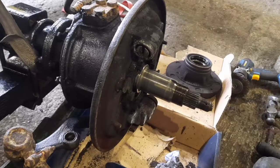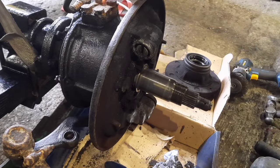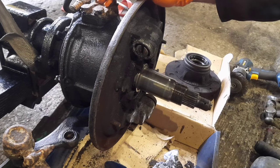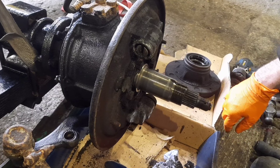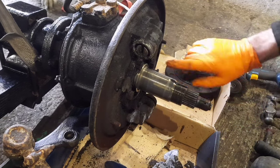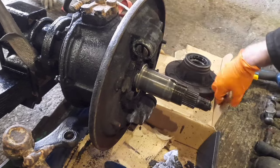The wheel cylinders, obviously all this lot of scrap. So we'll pull the cylinders off, pull all these brake pipes and stuff off. I've got the lock tabs to replace on this side as well. And I'll get in there with the wire brush, I think, try and tidy up the back plate and get a thin coat of black paint on there just to coat it up. See if the adjusters are nice and free or not. I'd imagine they're partially seized as the other side was.